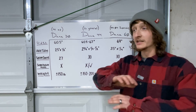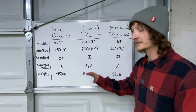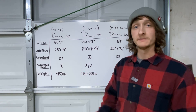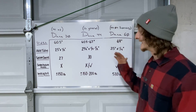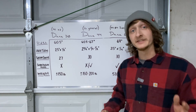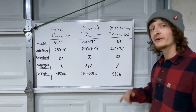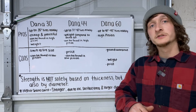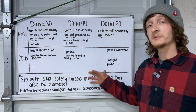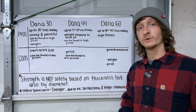Another giant factor in these axles is the weight. A Dana 30 is about 150 pounds give or take, a Dana 44 is somewhere around 150 to 200 pounds, and the big one — the Dana 60 — comes in at about 530 pounds fully loaded. Along with the basic info, I decided to put together a pros and cons list for each axle.